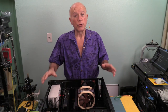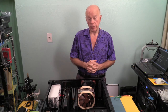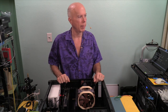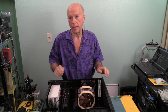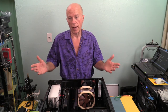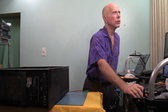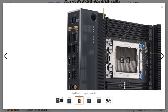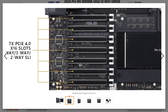Let's look at the Supermicro board. If you notice the IO panel on the back, there's no shroud on it. We've gotten used to having that, I believe starting with the X399 and TRX40. That particular Supermicro motherboard has no shroud, so that's something else you've got to assemble. Now let's go back and look at the ASUS board — if you notice the back IO panel, it's already on. Nothing there to attach, everything's covered. And we have one, two, three, four, five, six, seven slots.